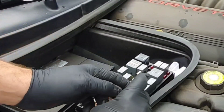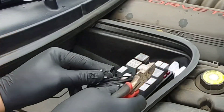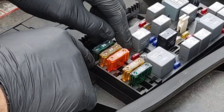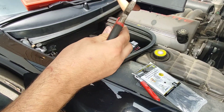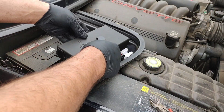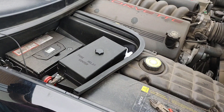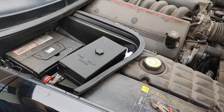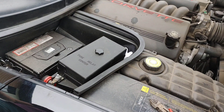I'll leave the relay in. Now what you want is to run the wire between those two fuses. I'll make a little notch for the wire as it came out of the box, and now we are ready to put back the fuse box like this. One advice: you don't want this black wire attached to the relay to touch any positive, so keep this wire away from any source of positive like the battery.